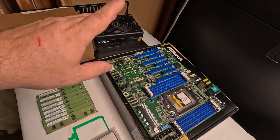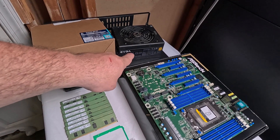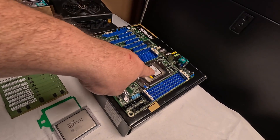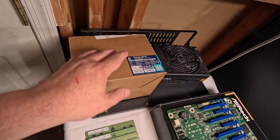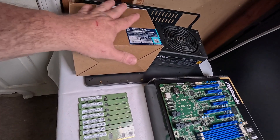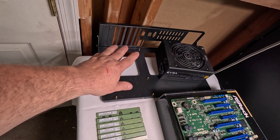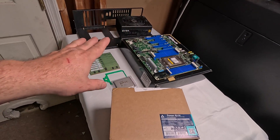We've got to make sure we're cooling the VRMs. For the power supply, I got that used off eBay for $60 — an EVGA 750G2 80-plus gold. More than enough to run a single EPYC at 225 to 280 watts if we can play with the BIOS settings. To cool it, I'm using an Arctic Cooler Freezer 4UM. The rack underneath is one of those $20–$30 racks, graciously donated by Rondi — thank you, bro. Without further ado, let's get the build on.